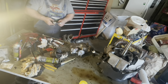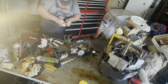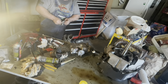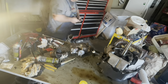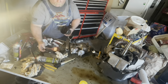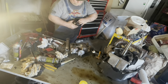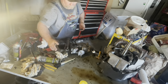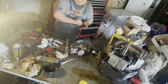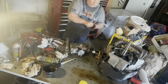I used red gasket sealer on it. Here I am opening up the package to our new seal and getting ready to install it. We've got to have some grease — this is Yamalube grease right here, it's a high quality grease. Get some of it in my hand. We're going to pack it the old fashioned way, just take a packet just like you were packing a wheel bearing. Yes, it's messy.